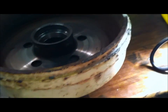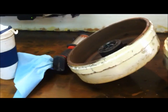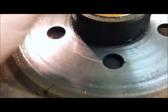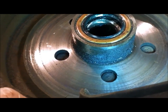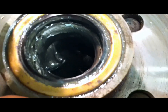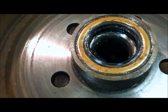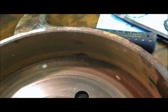Put it up on the bench. Here's the back side of the hub slash drum — this is a brake drum, all in one. This right here is your grease seal. If you look, you can see that it's moist, so this seal had been leaking. The reason it was leaking is because this hub's been moving on that axle because of the bad bearings. And if you look down in there, this is your bearing. We're going to get that out. The way to get it out is we'll flip this hub over and go in from the front side with a long punch and a hammer and just pound the whole situation right out.